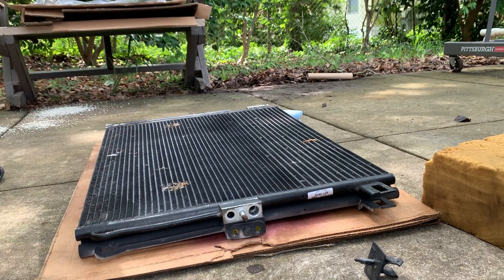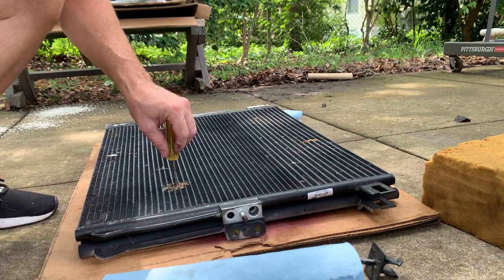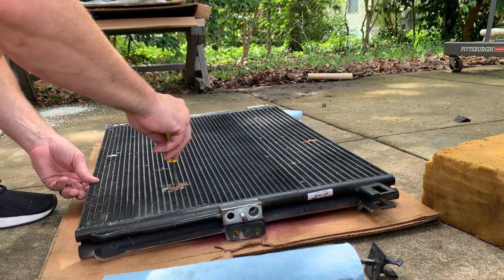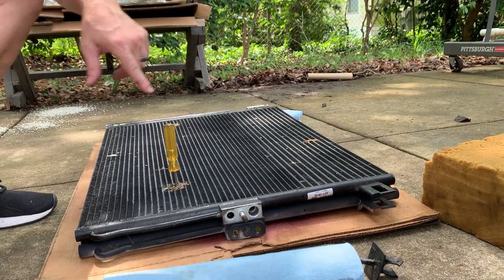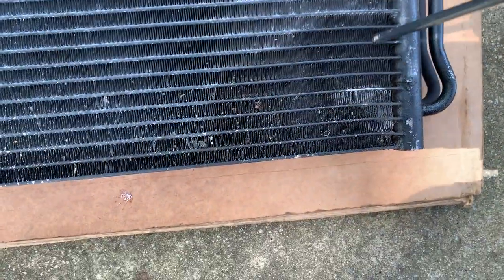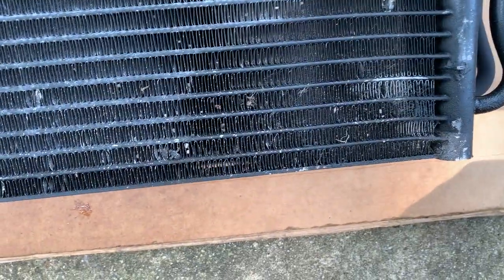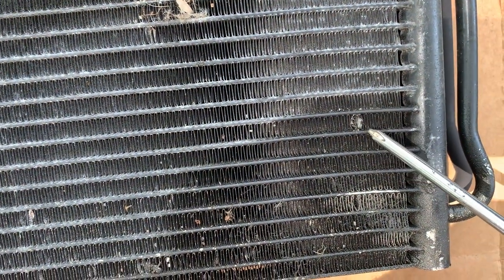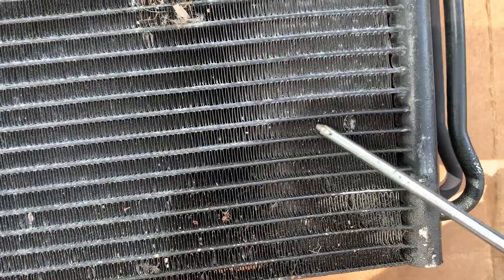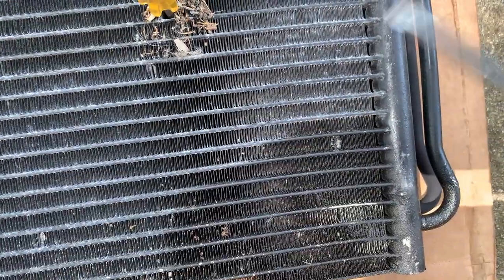as possible. Okay. So what we're going to do is get a really small Phillips and we're going to basically very gently work through the other one because you just want to lightly spread, kind of push apart these fins. So when you're going through, I'll just exaggerate because this is junk, okay? You're basically just spreading them apart. You don't want to damage this guy here. The cooling fins, they can be bent and whatnot. Nothing goes through those. But through the solid part here, you don't want to. I imagine someone could, but you don't want to mess that up.